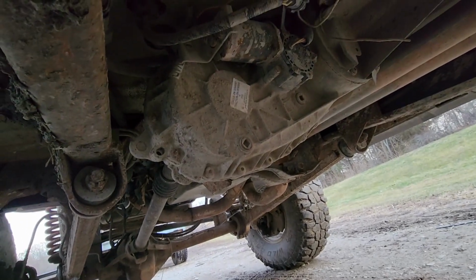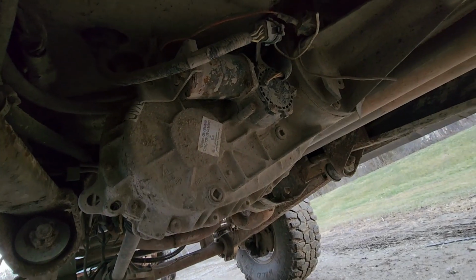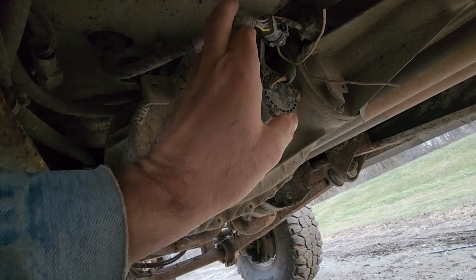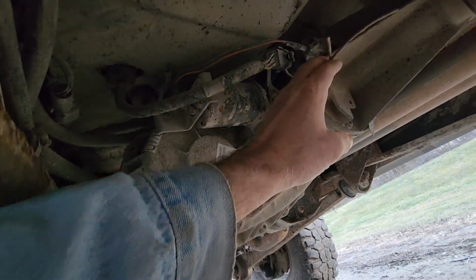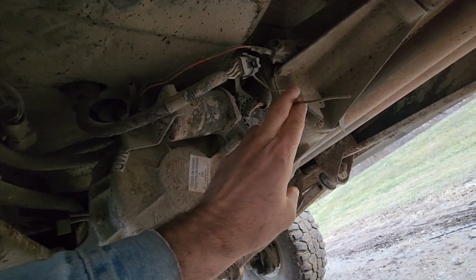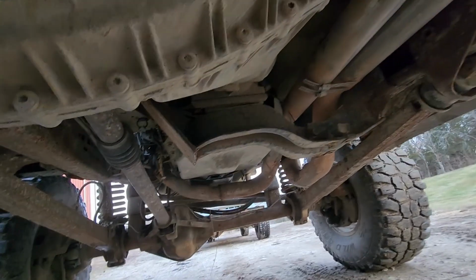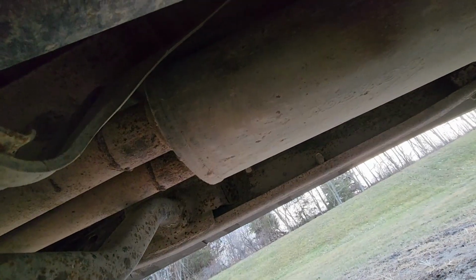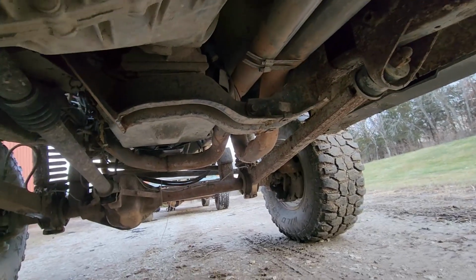Same spline, same bolt pattern, and electric shift, which worked perfectly with the Sport Trac wiring. The only difference here is these are the Control Trac wiring that were in the Expedition. Dual exhaust, running into a MagnaFlow, dual in, dual out, and it crosses over inside. Has a pretty good sound, if I do say so myself.